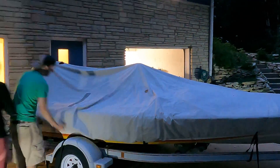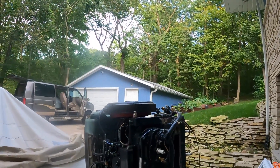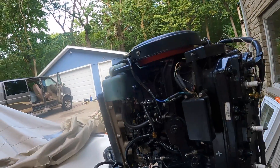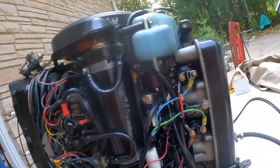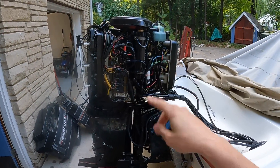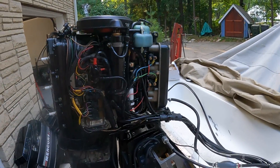We're about to pull the power head, but today was awesome — we had a carbon fiber flight board e-foil thing, super fun. We're going to start by removing the socket that I left on the engine, then we are going to disconnect the fuel lines, the shift cables, and the harness. My goal here is to just lift the power head up, pull the gaskets off of it, and see if there's anything blocking it — which I'm sure there is — put new gaskets in it, and then drop it back down. Let's live dangerously and leave everything connected.